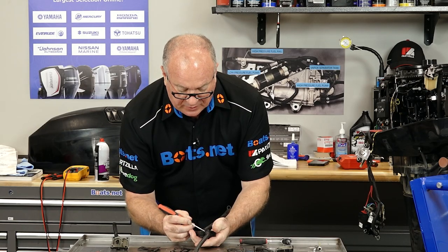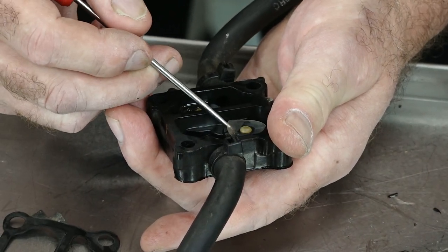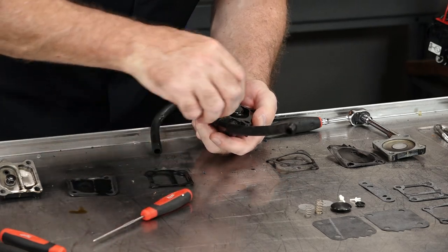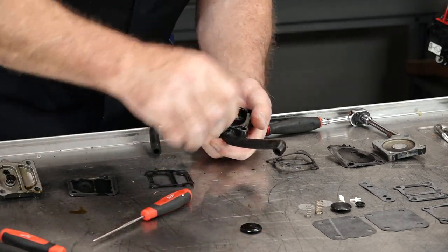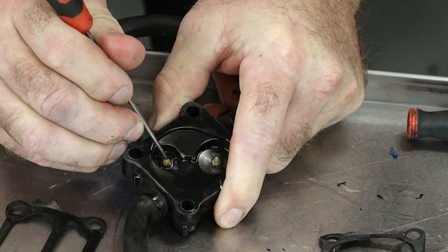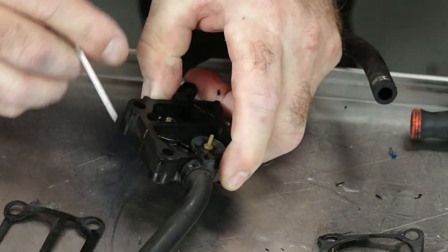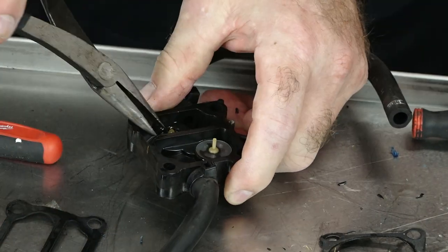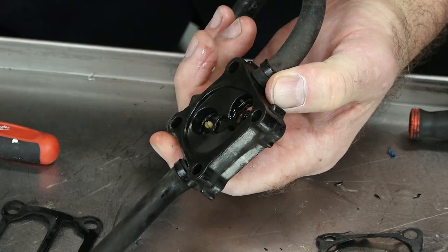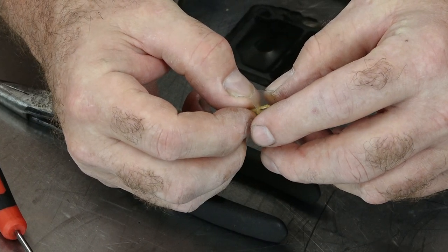Let's start by getting our check valves out. You can tell that this is a later model unit because these are plastic or nylon, like the ones we will be replacing them with. Now if yours is an older one, you have to drill out for a larger pin set for that little retaining clip to go back in. Let's go ahead and get the spring and cap out, which we will be replacing as well. All I'm doing is just pushing in on that center pin to release them. That's got some age on it — go ahead and replace it.